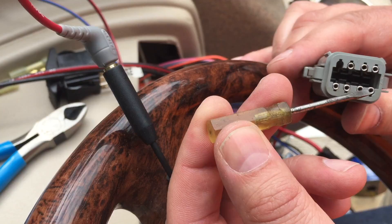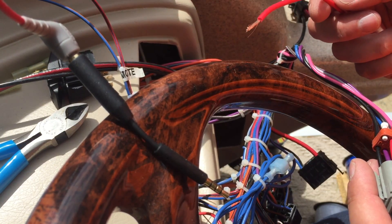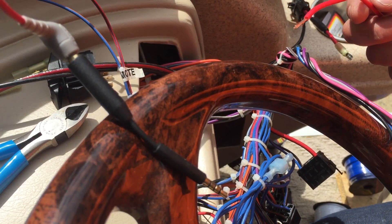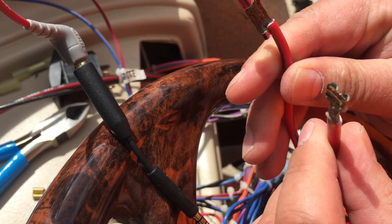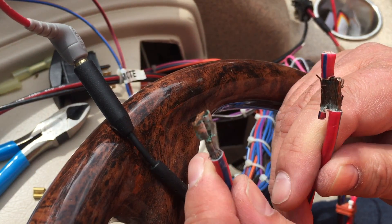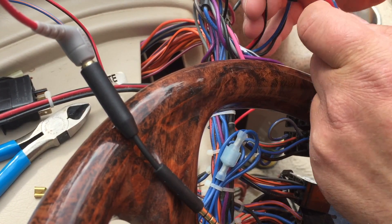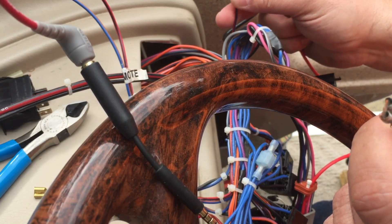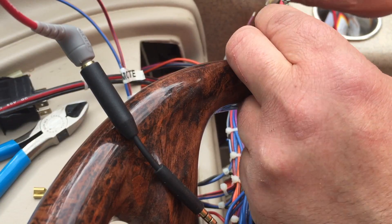This red wire has to get tied in with other red wires, so I'm doing one circuit at a time so I don't get things messed up. The wire we've got to connect to is this corroded thing, and believe it or not all this corrosion happened just from firing up the engine and testing it. Electrolysis can happen pretty fast. This pin went into a block that went on a switch, so I've got to tie this Deutsch connector wire, another hot wire that's still good, and the replacement wire all together.